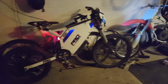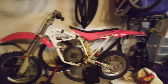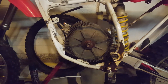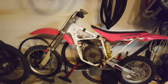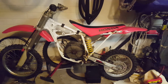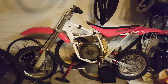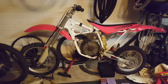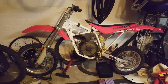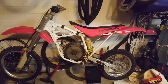Over here there's a CR80 that I'm going to convert. That's a Zero electric motorcycle motor I got a hold of — it's used but should put out somewhere around 81 horsepower max. I'm going to be putting a Sevcon Gen 4 Size 6 on there, so it can do a max of about 660 amps. Running it at around 100 volts, that gives a theoretical 90 horsepower, though at about 60% efficiency at max power we're still looking at well beyond 450cc motorcycle-level power.